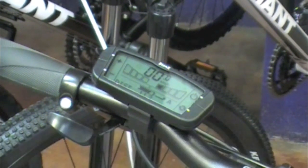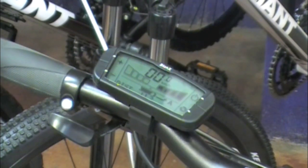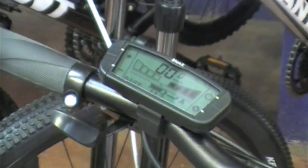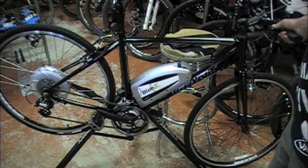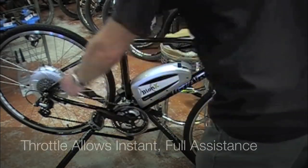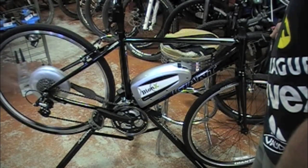To operate the system, we simply select our assistance level and start pedaling, and Bionics does the rest. It's got a very clever torque sensor in the rear motor that senses how much effort we're putting out, and any time it senses we're putting out more than the level of walking, it's going to kick in and give you a nice little bump to keep you moving. There's also this throttle mechanism right here — you can hit the throttle and have the Bionics kick in and give you power. The throttle won't work if the bike is stationary at a stop light, but if the wheel is spinning, give it a little spin, hit the throttle and you can see it kicks the rear motor in. That feature works when the bike is in motion.